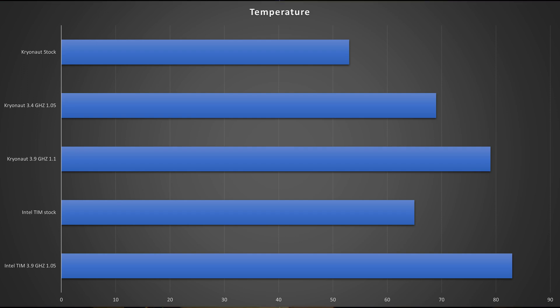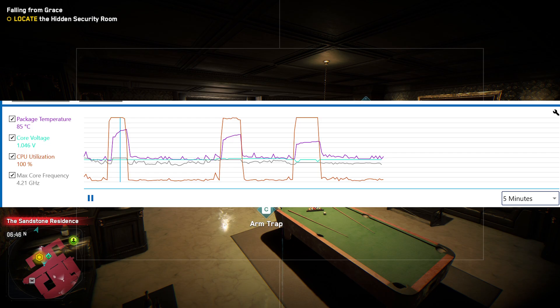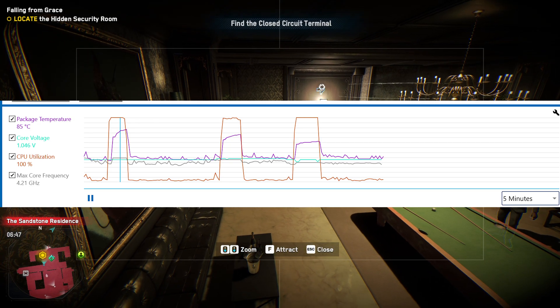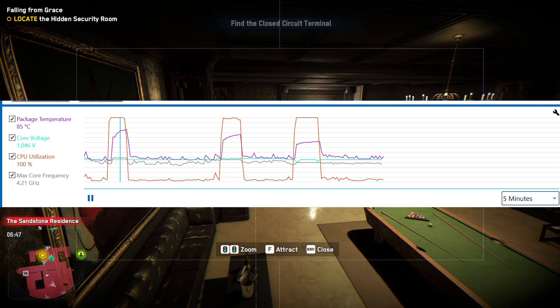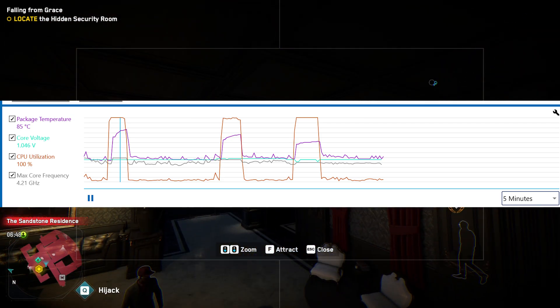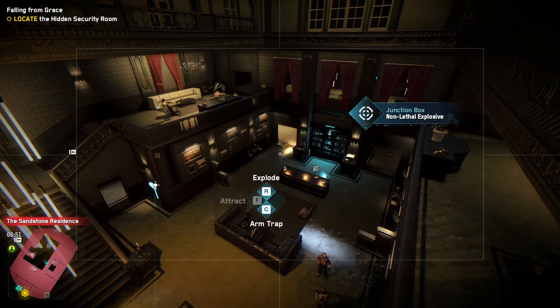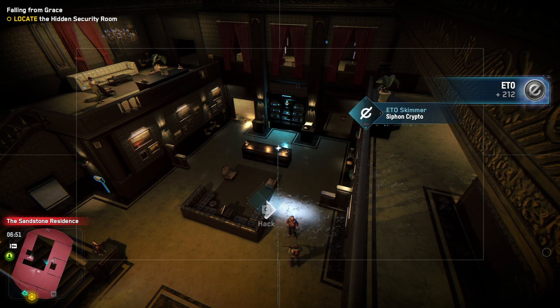That seems like a reasonable improvement. Finally, the voltage shown is wrong because this is a motherboard overclock, so it's showing 1.04 volts but it's closer to 1.10. We can sustain an overclock of 4.2 GHz on the i9-7980XE on the Noctua D15, which would not have been possible before — I tried, and with the stock thermal interface material I couldn't really get a decent overclock out of this thing. That is an insane overclock — almost as good as what I was able to do pre-delid on custom water.